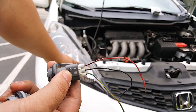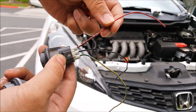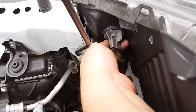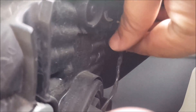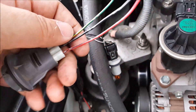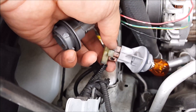To wire this up, you're going to take the ground and positive turn signal and tap them here — ground here, positive turn signal here — and then take the positive wire from the parking light that's up there and tap it into this wire. Here is the front parking light socket. To remove it, just turn it counterclockwise, disconnect the wire harness by pressing the tab, then remove the parking light. The wire I'm tapping for the parking light is the gray wire — I'm going to connect it to the red wire. The middle ground wire and the turn signal will come from this wire harness, so just press that tab and remove the socket.